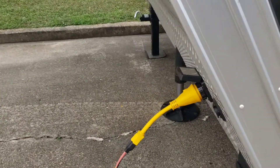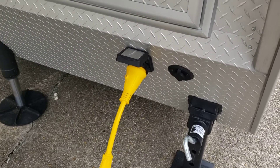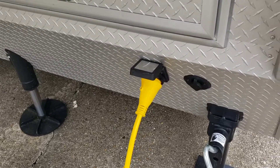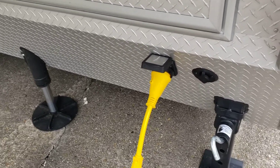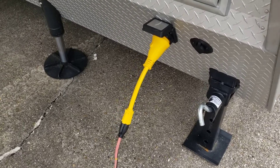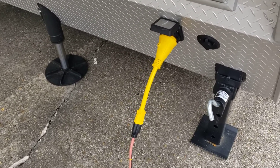If for whatever reason your inverter stops working and you have no more power, there's basically your standard trailer connection which will work as a bypass. By setting up a direct feed you can bypass your entire inverter. That assumes your trailer has an automatic transfer switch, which most trailers of this class will — meaning they detect shore power so they don't need the generator running. In our case the generator works as the inverter, so this bypass is available if you need it.